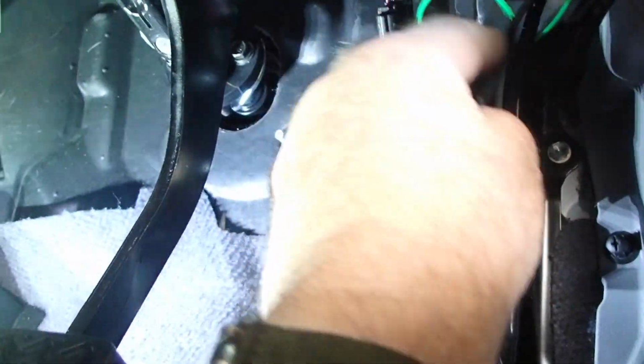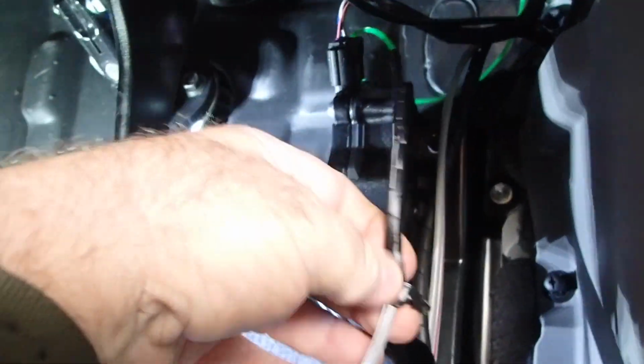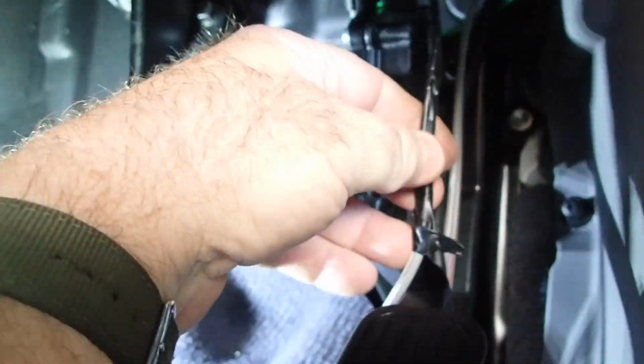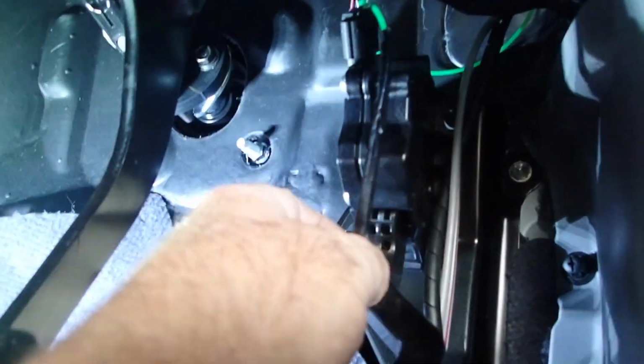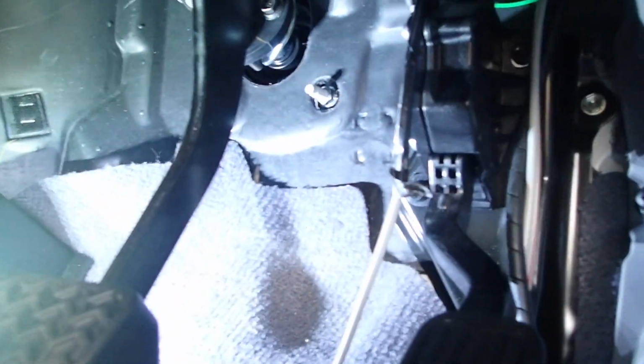Right guys, so there's my whippersnipper cord. Now I want to make sure I don't catch up on here. So I've taped the whippersnipper cord a good distance on the wire. I'm going to lubricate this with lanolin spray in the grommet, and my positive cable's down here. So I get the first half of the cable through, then I can adjust the length. So just go slow and steady, don't be tearing it, because you don't want to be catching any wires or anything. So just take your time.